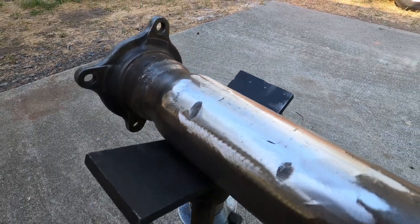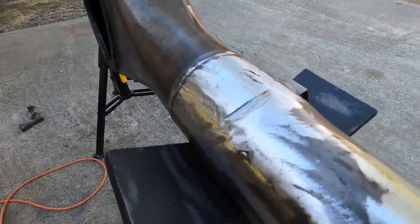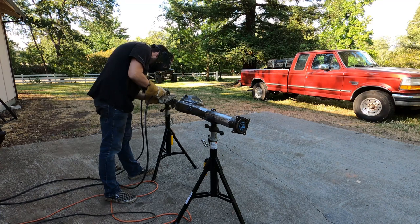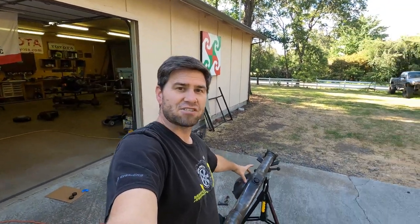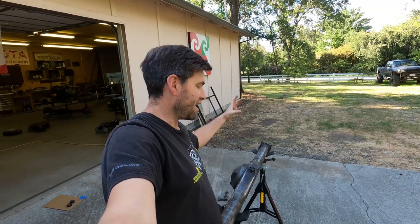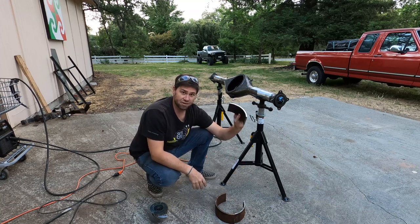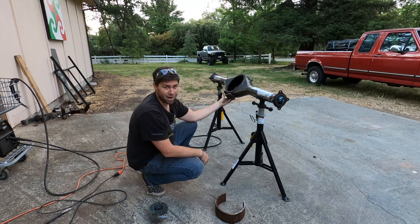I've finished all the grinding on this axle that I'm going to be doing right now, but I did gouge it in a few places. So I'm going to have to grab the little welder, fill in the gouges, and then grind those smooth once again. Then I can start cutting the bottom side of this axle and take this chunk out and put in a bigger, thicker plate so when I hit rocks, it's not going to ding this axle up. I got a 9-inch diameter pipe and cut it into quarters because I'm going to use a chunk of this for plating the bottom of my axle.